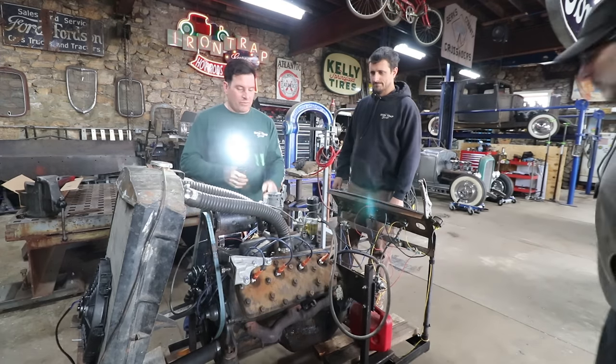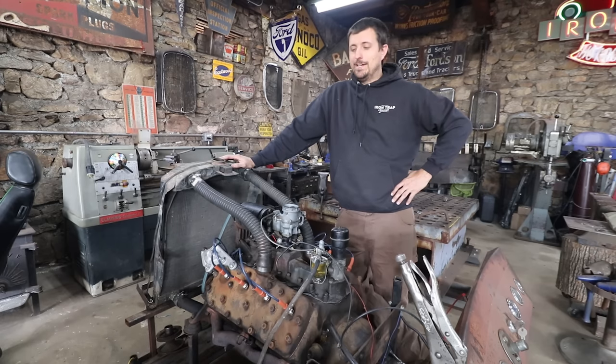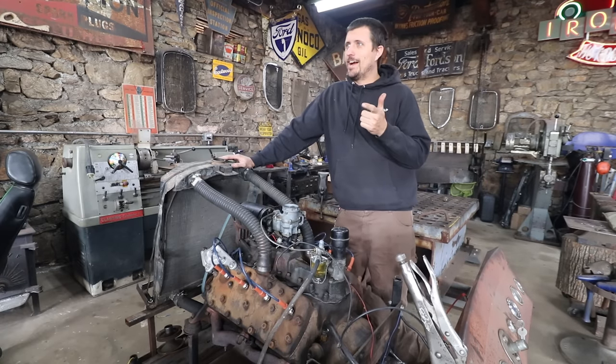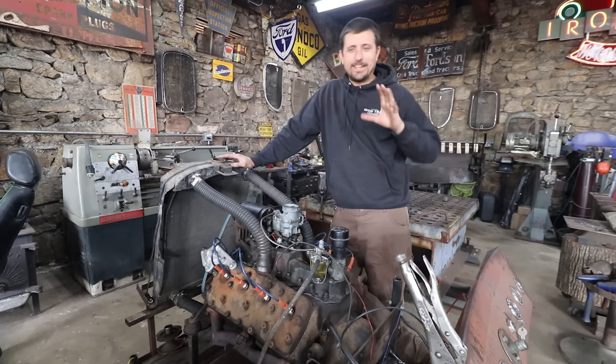Here's a screwdriver. We got this thing all adjusted for that rowdy engine. Oh, right. Okay. All right, so you're happy. Yeah, it made noise. I didn't totally mess everything up. It was timed correctly, and it fired off. The timing thing was a little funky. There was no mark on the crank gear, so I had to do some thinking and I got it right.